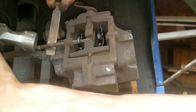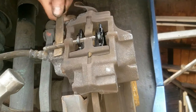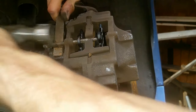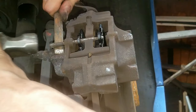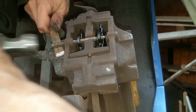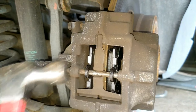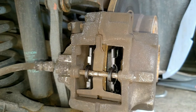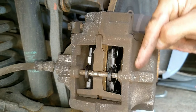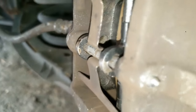Here's another helpful trick: grab a flat bar and bend the pin so it's straight, then hammer it in. You shouldn't have difficulty lining up the pin through the pads, but if you do, you may have bad pads. I previously bought some Bosch brake pads and one or two were faulty and made a terrible squeal noise, so make sure you check customer reviews before buying any pads so you don't have to redo the job. All tools and supplies are in the description below. The end result you're looking for is the pin's end tip sticking out just like it was before you originally removed it.